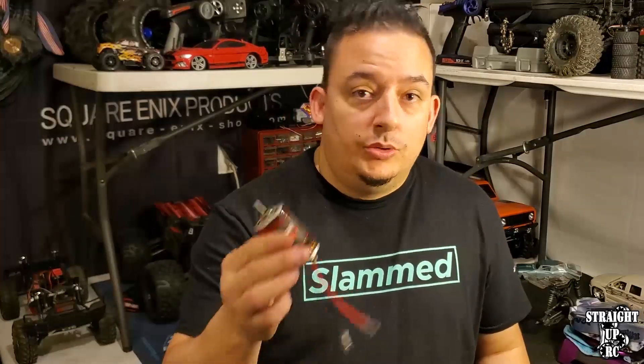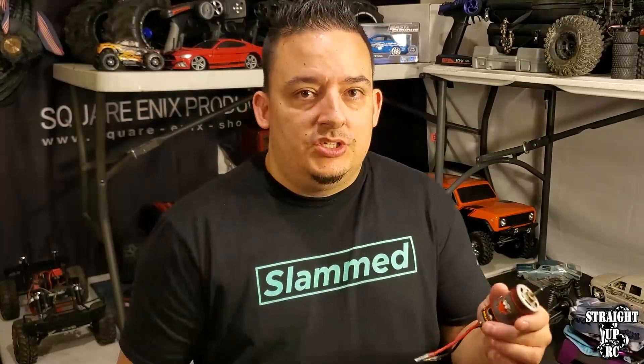Some people may not know the difference between brushless and brushed, and that's fine — that's a whole other topic. This test process is a simple and easy on-the-spot test you can conduct with any brushed model RC car to identify whether it's your motor or your ESC. Simply put, the test is supplying power to the brushed motor from a power source like a battery, to give it the voltage that the ESC would normally give it. It's a direct test to identify whether or not the motor works.